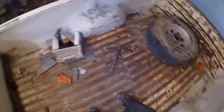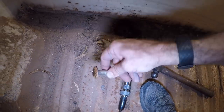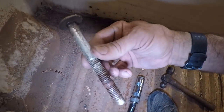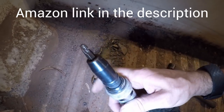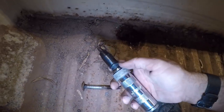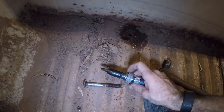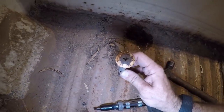I'm in the bed here getting ready to remove it. The only bolt you get to from the top is this front one, and it has a Phillips head on it. I knew this was going to be a struggle. The tool I used is this impact driver — it's got different heads, in this case a number three Phillips. You strike it on the end and as it's impacting, it slightly twists the head. It's good for something that's totally rusted solid into place.